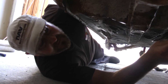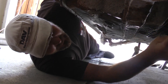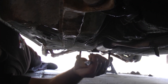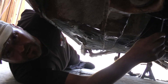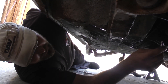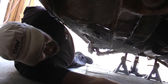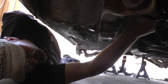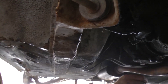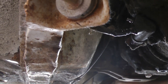We've already topped the reservoir as full as it can get. You never want to go empty on your reservoir because when you're bleeding, the whole purpose is to get the fluid from the master to the slave perfectly actuating the hydraulic rod. You have to make sure it never runs dry. We're totally full, so I believe we'll probably get it right the first or second time. I did a pre-bleed — you just loosen the nut on the clutch slave cylinder and let it free-bleed from gravity. It's bleeding out very smoothly, which means it's pretty much already done.